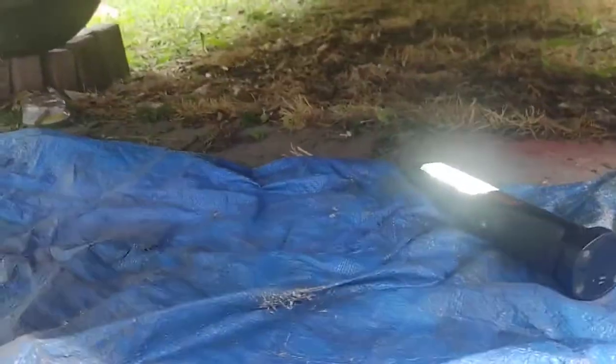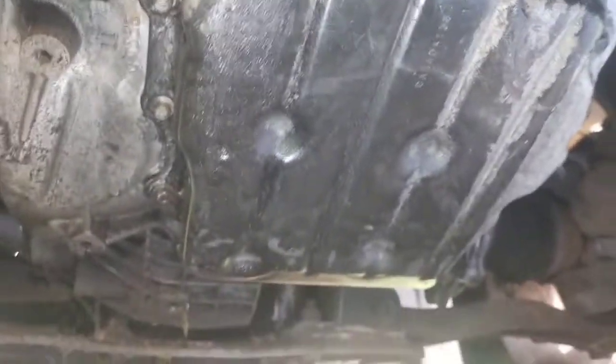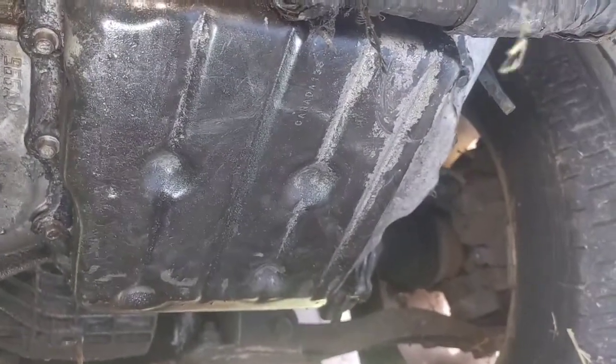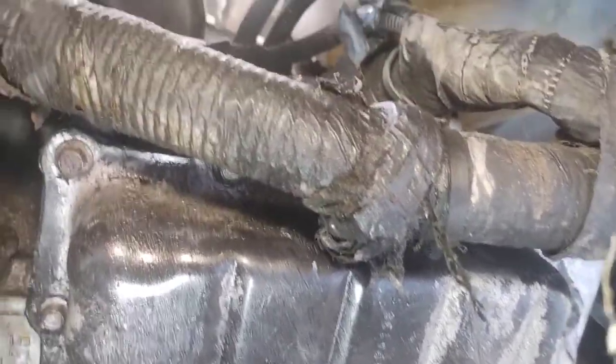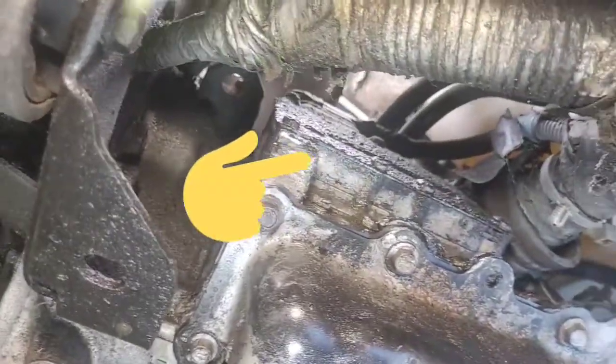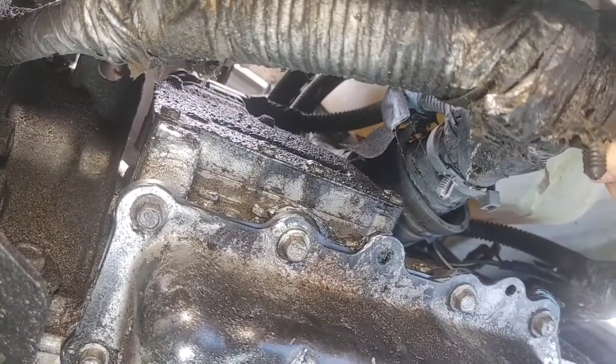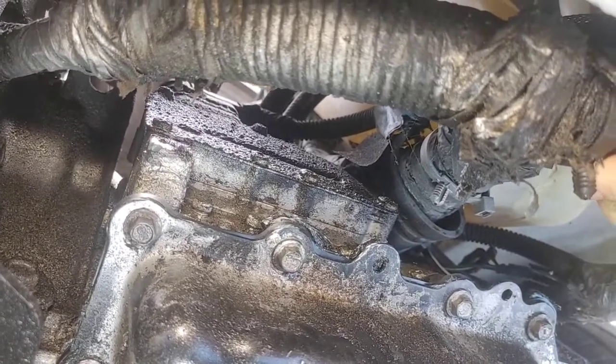If you go ahead and follow me under the vehicle, the 2003 Dodge Caravan, we're replacing the transmission valve body today. Right there is your transmission pan. If you have not switched your filter and gasket lately, this would be a good time to do that as well. There's your transmission valve body right there. It's held on by three long 10-millimeter bolts that are on the top side. You don't have to go from the bottom if you do not want to.